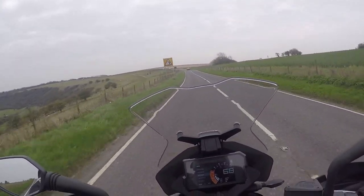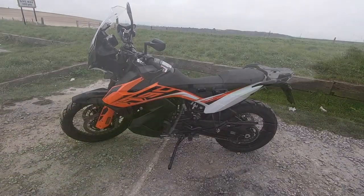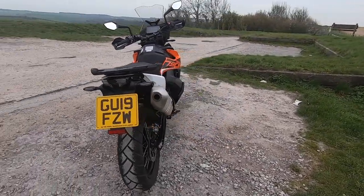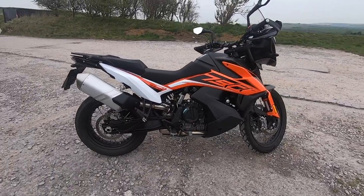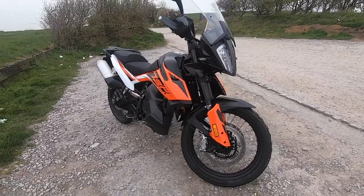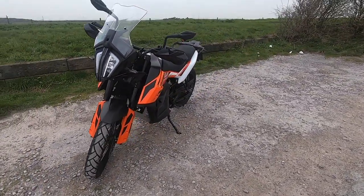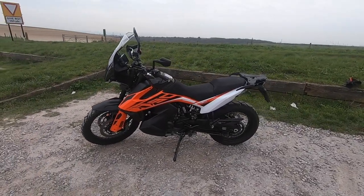Could this be a sub 1000cc KTM license loser? Right, just going to run through the technical details about the bike. It's a two-cylinder, four-stroke LC8c inline twin. The displacement is 799 cubic centimetres, obviously 790, which you'll find this particular engine on the Adventure and the Duke. The power is 70 kilowatts or 95 brake horsepower with a torque of 88 newton metres.